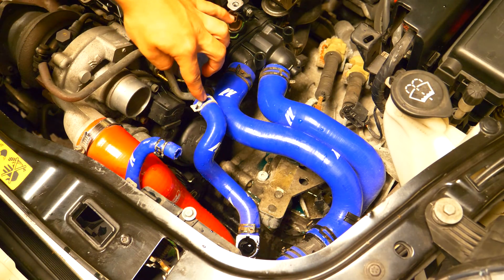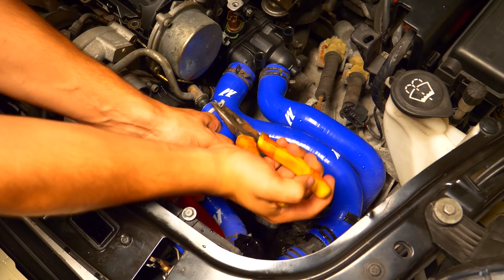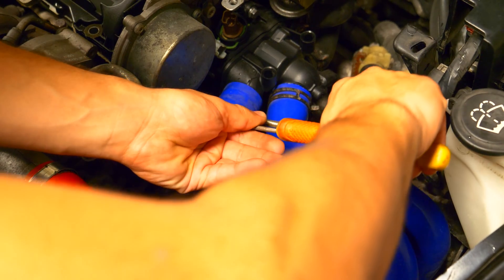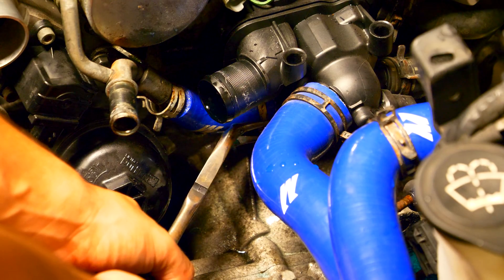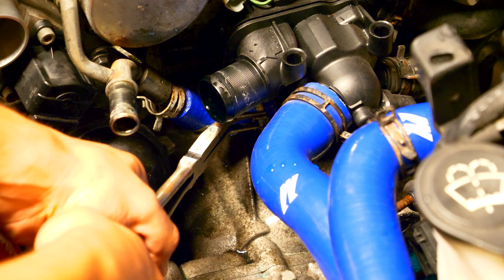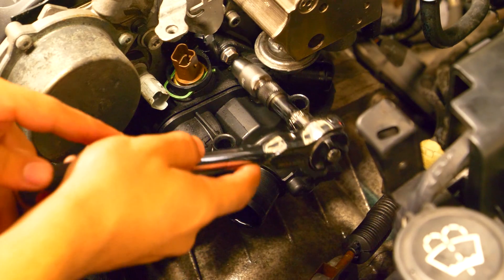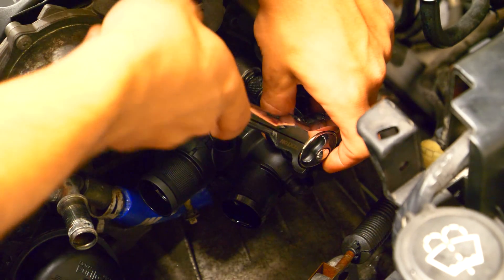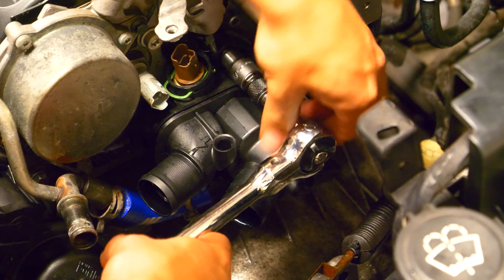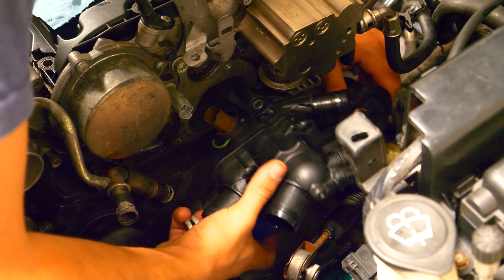You're then going to be repeating this process for the remaining hoses in the engine bay. We're going to continue by removing the one hose connected to the expansion tank that's leading to the turbocharger's hard lines. Remove the clamps along with the hoses attached to the thermostat. Some of the clamps might be a little tricky, so if you can get an angled set of pliers or a hose clamp plier it will make life easier. Don't forget the hoses found on the backside of the thermostat connecting it to the heater core — one leading to and one coming from the heater core. With every one of those hoses now disconnected, we can remove the three 10 millimeter bolts holding the thermostat to the cylinder head — one on top, one on the bottom, and another on the front. With all three removed you can move the entire thermostat and set it aside.